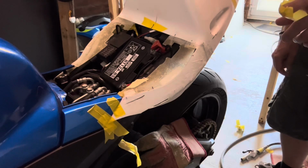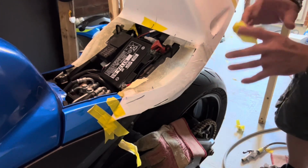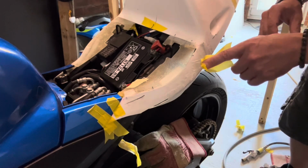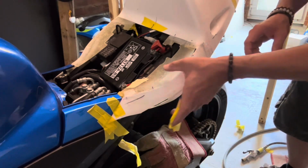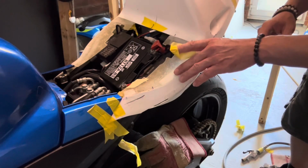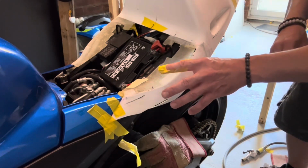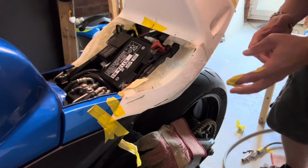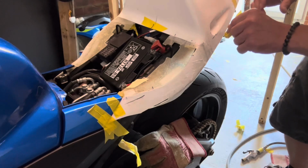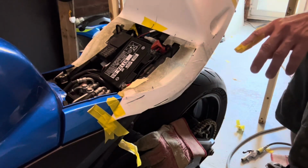Right, okay, I'm back. This is the next day because actually this has been a complete and utter nightmare. I've been really struggling and I've yet again just carried on without recording because it's just going to take me forever. But what I'm quickly going to do and show you is I'm piecing it back together, and what I do is use a little bit of fiberglass cloth and a bit of super glue and really quickly just mat it over and glue it, and that holds it strong enough for me to then remove it and fettle things. So I will just really quickly do this. I've got to put my mask on because I'm allergic to the activator spray. So I'm not going to chat. I'll just get on and do it.